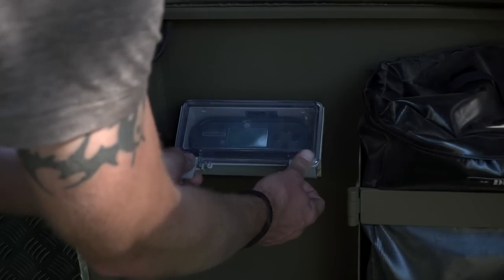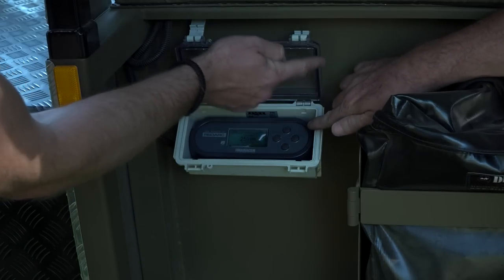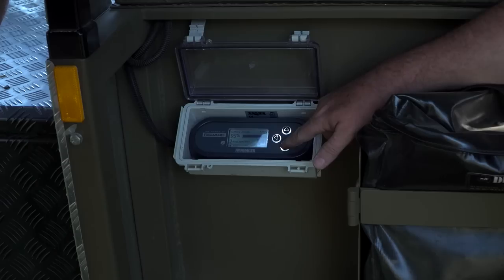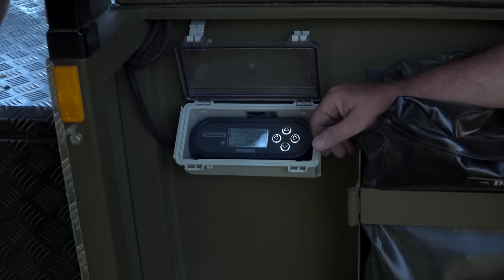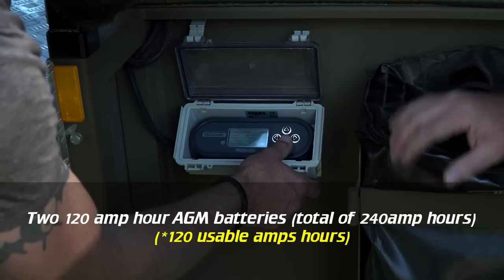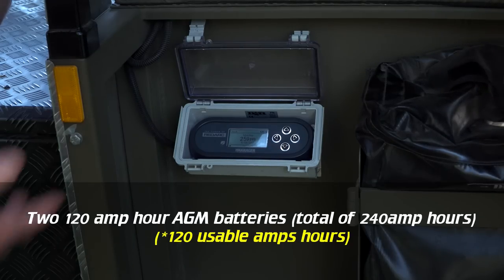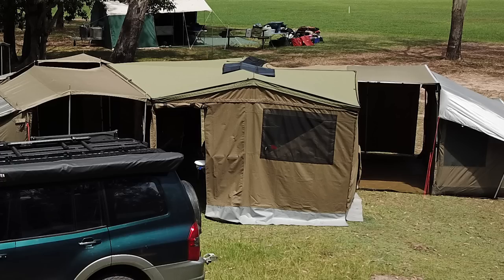So that's the fridge drawing about 5 amps at the moment. I've got two 120Ah batteries in there — 240Ah total — so you really want to know where you are on longer trips. And I use a RedArc 180-watt solar blanket — just pop that up on top of the trailer, plug into the solar input on the side of the trailer, and because it's a RedArc BMS it's got a dedicated solar input. That keeps everything topped up nicely.